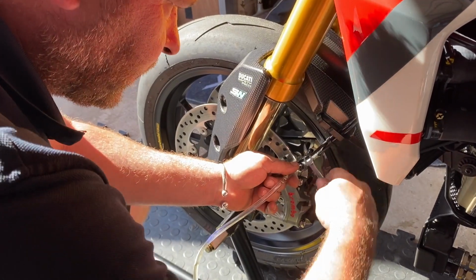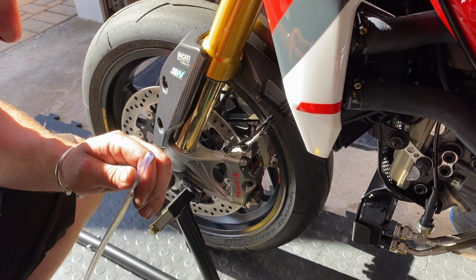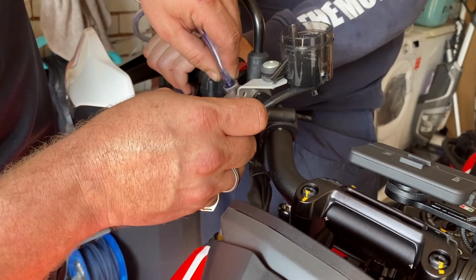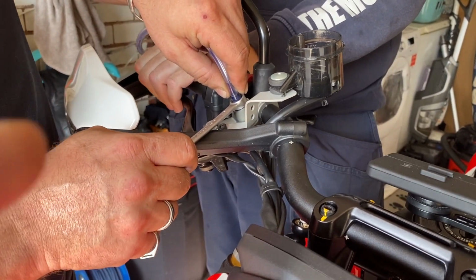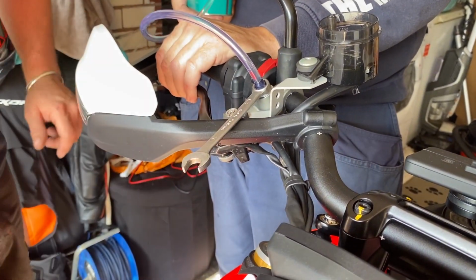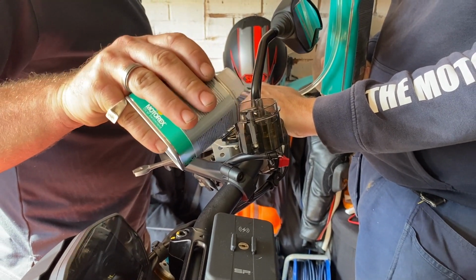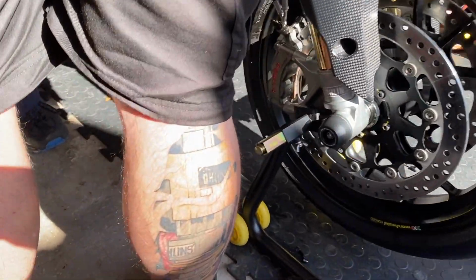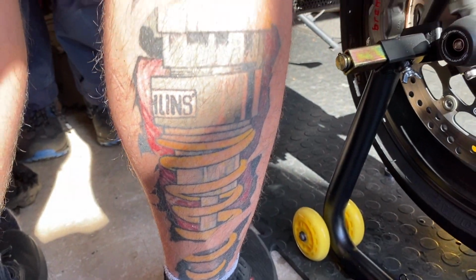Okay, stop it. Hold on. This is doing it on the master cylinder as well. So is it down there, then up the master cylinder, back down again? So like up and down. I'll pull it into the bar and do it one more time. Bleed it. Do it, pump it down. All the air's out of it.